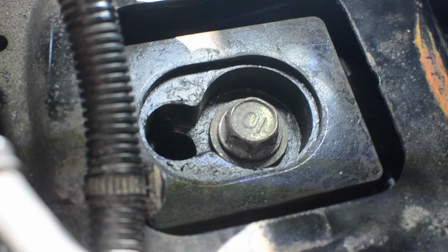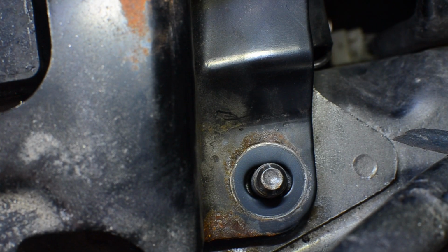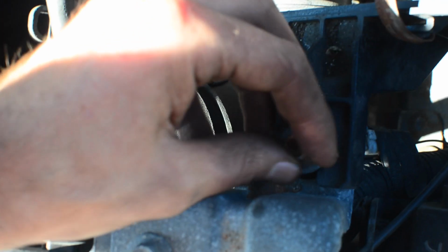So we just ran down the bolt, about 100 foot-pounds, and you can see that the little nut that is part of the transmission on the left has risen. So that means that we've properly threaded the bolt in and aligned the transmission properly. Run the nuts back on these, 60-ish foot-pounds, so again 4 17mm, and then hand tighten this 10mm bracket bolt. Go ahead and reinstall this forward bolt on the front. Again, hand tight on this one.